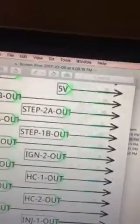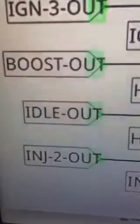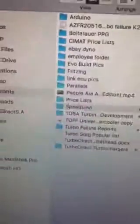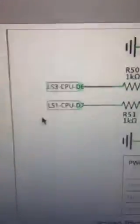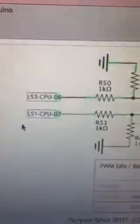What does that tell us? Let's go back to the schematic. Pin 37 — according to the schematic — relates to Idle Out. But where does Idle Out connect to physically? Idle Out connects through Q7 on Arduino pin D6.